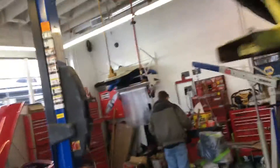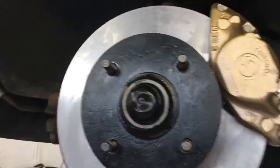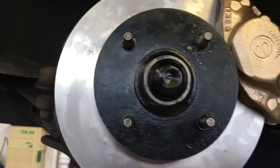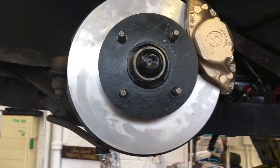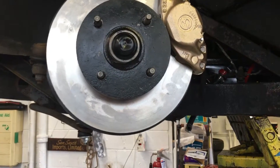We're going to walk around. It's on our lift, one of our older ones — one of the oldies but goodies, except it always has the center all covered up. But you can see our brake work. That's the original caliper rebuilt — got the G for Girling on there. And rotors, wheel bearings packed with water-resistant 22,000 pound RV grease. Nothing's too good for our customers — a little bit more money, but really good top-of-the-line stuff.